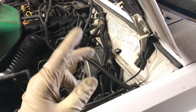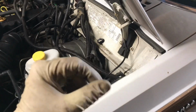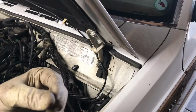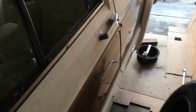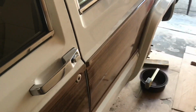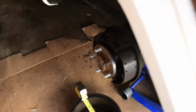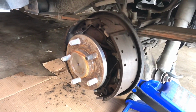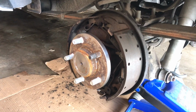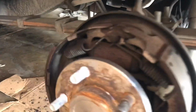they're like, yeah, the wheel cylinders on these with the ABS had a smaller bore. Now I assume they're talking the bore of the internals, volume of the fluid. So you're getting less fluid on a vehicle with ABS. Maybe something to do with because they're pulsating brakes, perhaps, or it's got to be something with the ABS. So because I'm going to a non-ABS, I think I'm going to try.